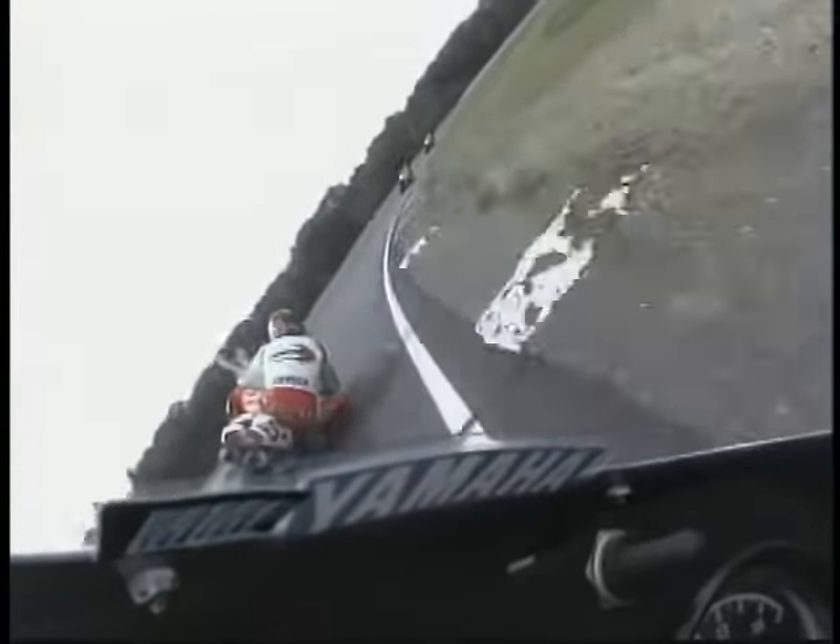The last section of this video deals with proper maintenance of a two-stroke engine. As with any type of engine, maintenance is a vital part of prolonging the life of a two-stroke. One of the most important items is the air filter. Most street vehicles use a replaceable paper type filter, while off-road vehicles use a cleanable foam type filter. Monitoring the filter's condition is very important, especially after riding in extremely dusty, dirty, or wet conditions. If the air filter is allowed to get over-contaminated with dirt, it will cause the engine to run very rich, or even worse, allow dirt to pass through the filter. Dirt acts like sandpaper in an engine, causing extreme wear. Excessive piston to cylinder wall clearance is one common result, which can cause piston skirt breakage if left unrepaired.